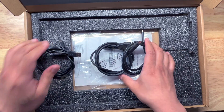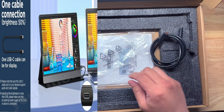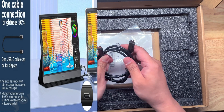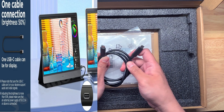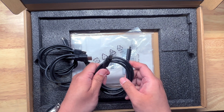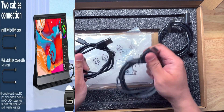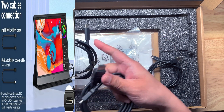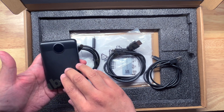For connectivity, you can use it straight to your Mac via USB-C to USB-C. If you have a Windows laptop or computer that supports USB-C, a friend of mine uses the same monitor on his laptop — he just plugs in one cable and doesn't need any drivers. If it doesn't power on that way, you can use mini HDMI to HDMI together with USB-A to USB-C for power, or USB-C to USB-C for power delivery. You can also plug it onto a portable battery pack, which I really love.